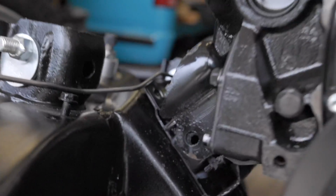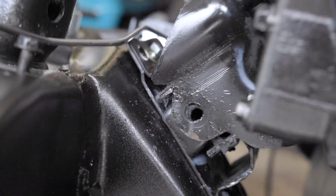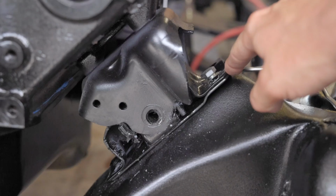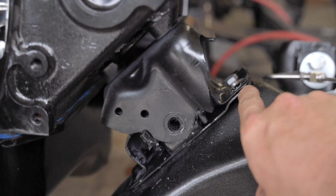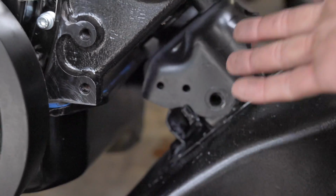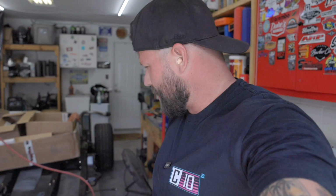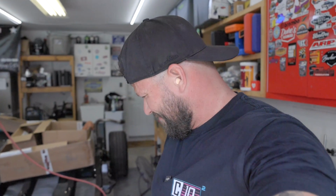And I got pretty darn close, man. I just did a test fit, just took some out of just the top hole just to make sure it's going to work. So I think I'm just going to clearance it a little more, do the bottom holes. Boom, there we go. So with just a little bit of critical thinking, I was able to get these motor mounts to line up. Yep. Well, let's wash them out and get this thing in here.